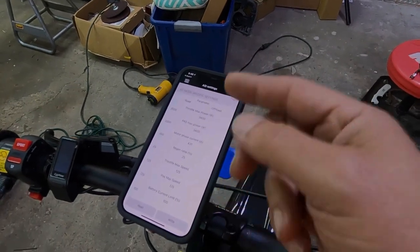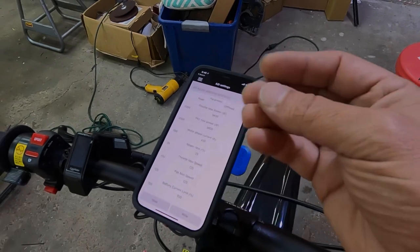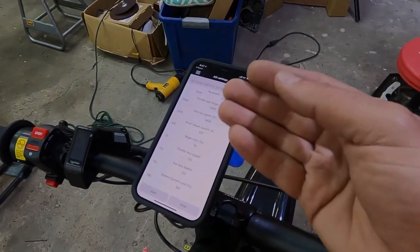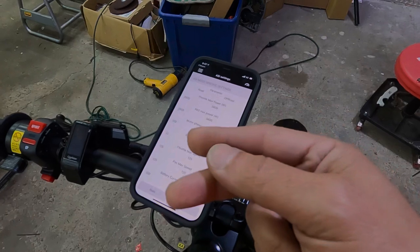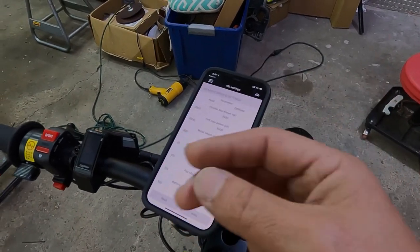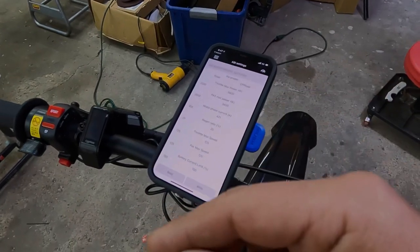egg rider app and bring down the settings to the 60 volt parameter settings, because if you don't, your battery is going to cut out because the power settings are too high, especially if your battery has a BMS, or the controller might still think that it's using a 72 volt battery if you didn't flash the 60 volt tune through the CYC app when you went back down to a 60 volt. So just remember to do those things and you'll be fine.